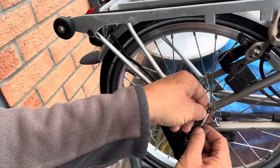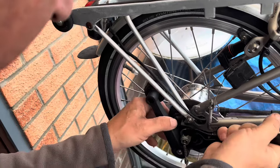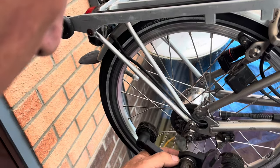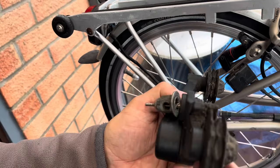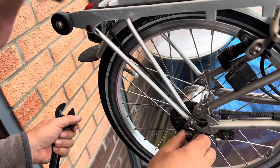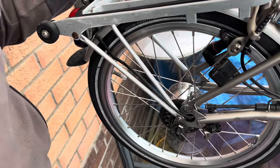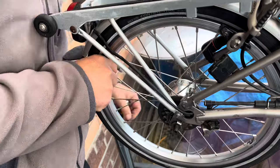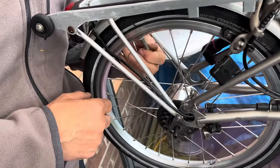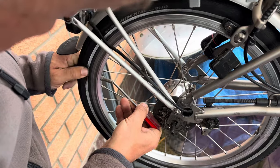I'm not going to run through the full procedure of taking off the back wheel — there are great videos on YouTube showing you how to do that. Take off the chain tensioner first. It differs depending on the model of Brompton you've got and how many gears you have. The last part of the job is just to let some air out of the tyre to enable it to slot through the back brakes, and off she comes.